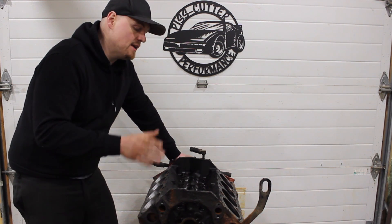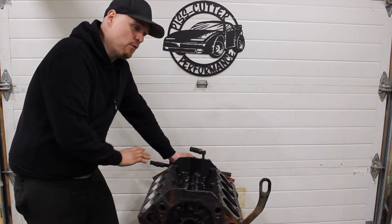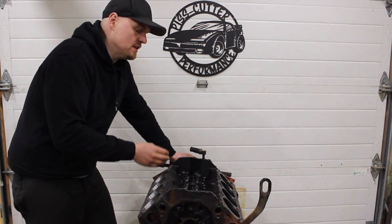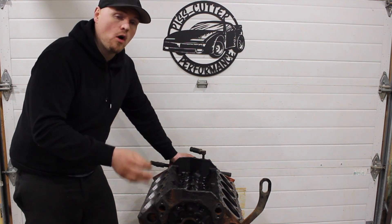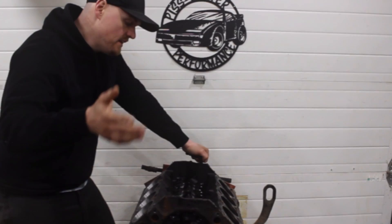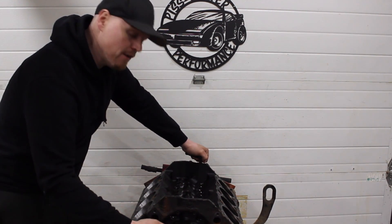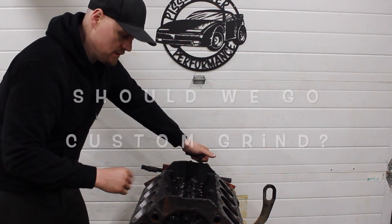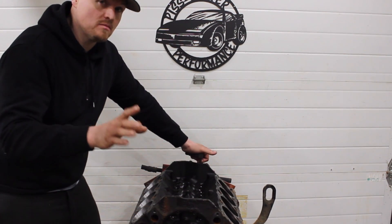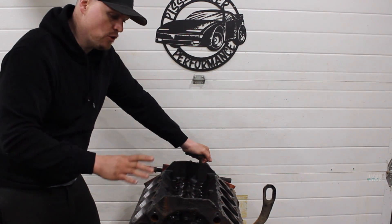The plan is to spend the least amount of money but end up with a good engine. We could slap an engine together and hope for the best, but if it blows apart after a couple dyno runs, all the work is for nothing. The point of this build is for guys willing to get their hands dirty and spend money where it's needed without going overboard. In my opinion, the L31 is the best 350 platform you can start with — you get the factory windage tray, blocks that don't wear much, a factory OE roller cam with a great lifter setup with hydraulic lifters, and the Vortec cylinder heads. As long as the heads aren't cracked, we might have really scored on this engine for what we paid. You can't really get a better bang for your buck, so we're off to a really good start.